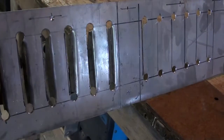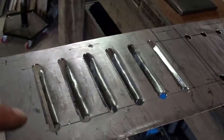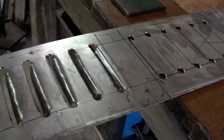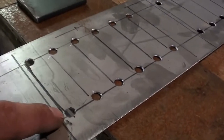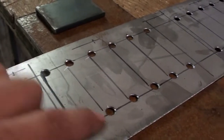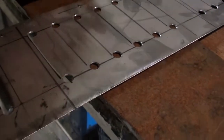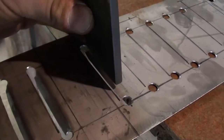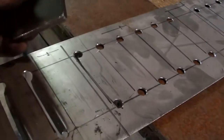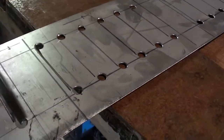So I've got a system to make these louvers. They're obviously getting better as they go along, but essentially you've got to cut it and clamp it down on a piece that's raised up here, and then I've got a kind of a piece of steel and I can actually bend it in, and then I've got to tap it down from the other side just to get it flat and even, if that makes sense.